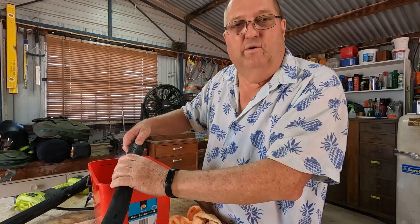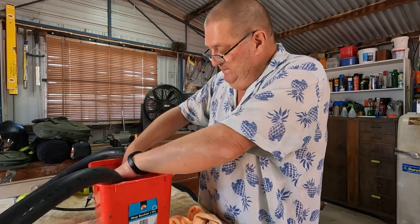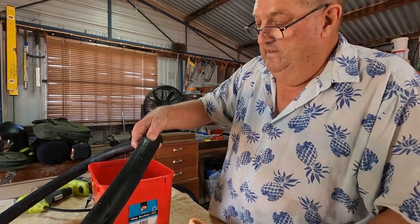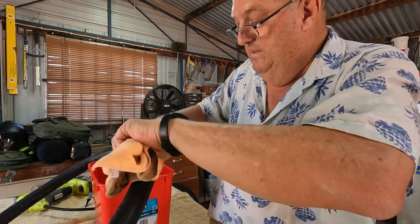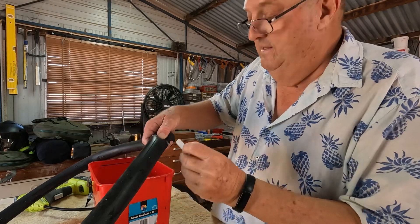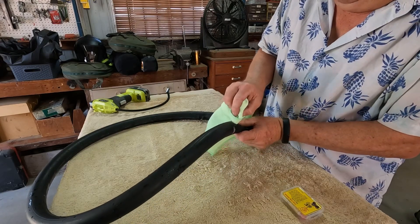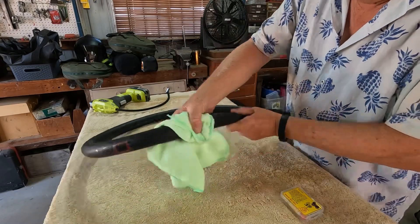Now what we're going to do is mark where the hole is in the tyre, which can be really difficult. What I like to do is put it back in the water and put my finger just at the front of the bubbles. Then I grab a little bit of chalk and put a mark there — I know that the other side of that chalk mark in the middle is where the hole is. So now I know where it is. The next part of the process is to dry off the water from the tube — I like to go all the way around so it's pretty dry.